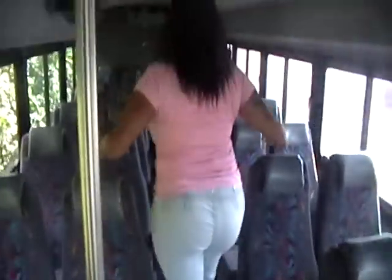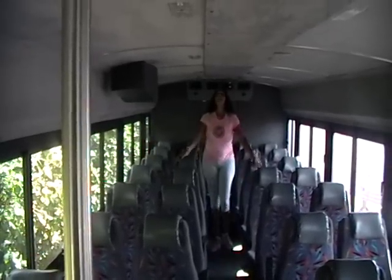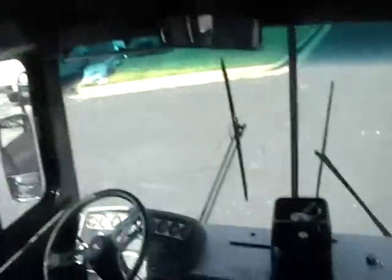Pull it in and lock it in — it's fast and tight. Then I'm going to check these chairs, making sure each of these seats are fastened, tight and secure, and seatbelts the same way. I come over here and check my emergency hatch — it is functioning properly. You can keep this open to get air coming through here, but this bus has excellent AC units. I'll be checking to make sure that you can see our sign saying 'stay seated,' and checking the aisle to make sure nothing is blocking it. This is called a standee line — no less than two inches, clean and clear for everyone to see, and you cannot step behind it when the bus is moving.